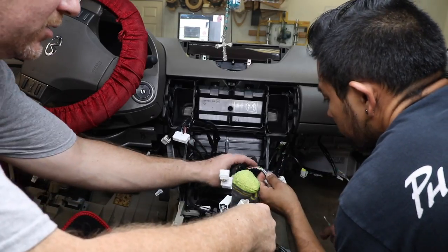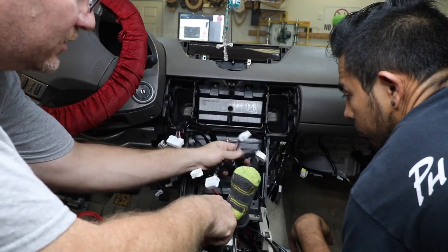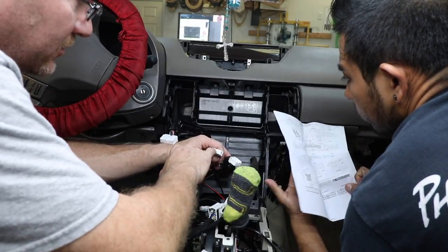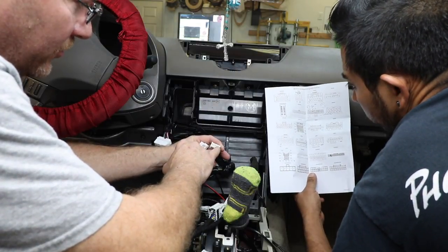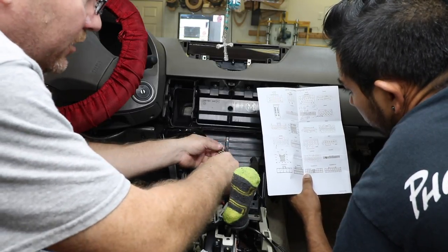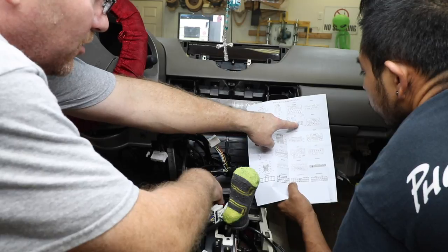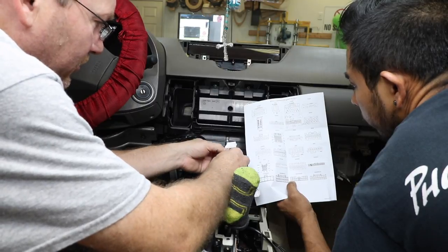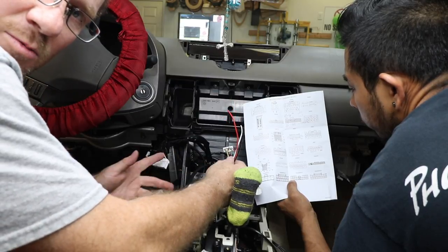Once you get into the car, grab the harnesses that were all attached to the radio. You have your two big ones that attach to the main connectors, then two other smaller ones. One of these is the harness we're looking for — you can differentiate it because across the top you have three and three, and a solid row on the bottom. The other one has two and three — that's not the one we want. Grab the one that's three, three, and a solid row across the bottom. Using the instructions: pin 23 is green, pin 22 is red, pin 25 is yellow. The numbers are located on the connector — flip it over, count, and you'll find the three wires. Attach your wiring to these wires and you'll be all set.